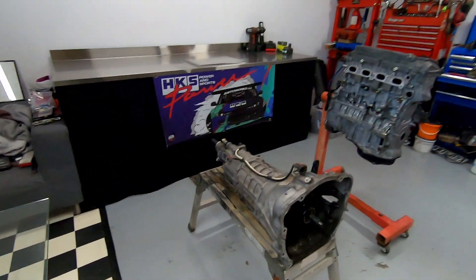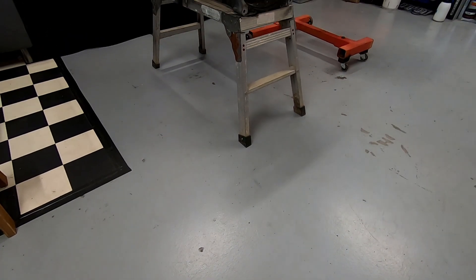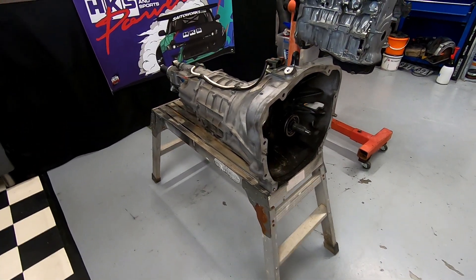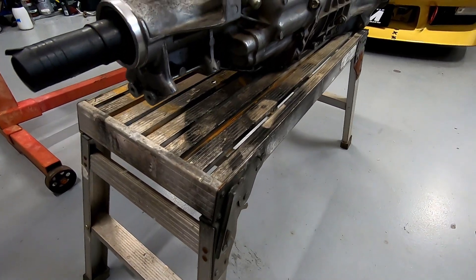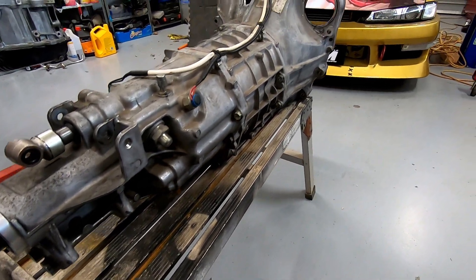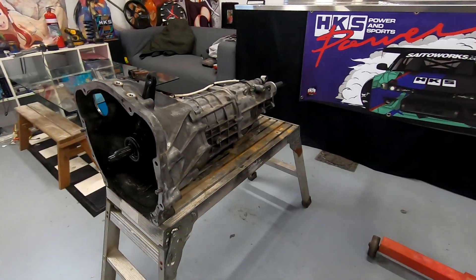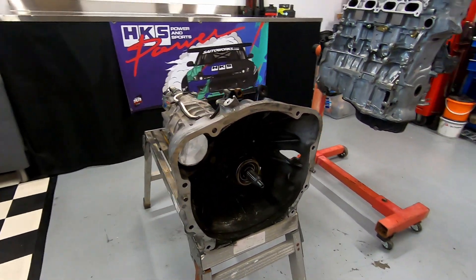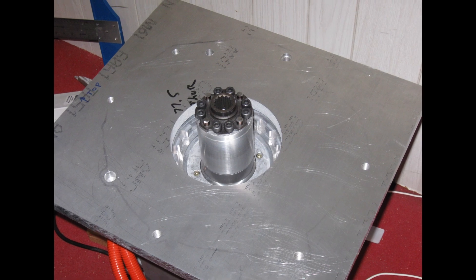My back is feeling good and my new gearbox is here. The most important part of this gearbox is the starter motor placement - the starter comes in from the transmission side, which is all too important with the 2AZ. If I were to fit a W58 gearbox I would literally have to remove a large chunk of block skirt webbing, which would create a weak point near number four. There are some points of concern with the physical size of the bell housing which I won't address in this video. For now, let's take a look at how we can make an adapter plate to mate the TL-70 to the 2AZ engine - the process and considerations are the same for making any gearbox adapter plate no matter what the engine and transmission combination is.